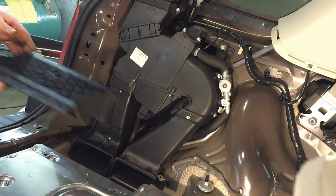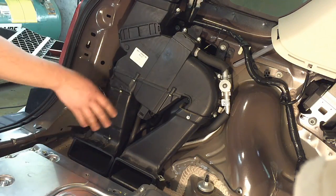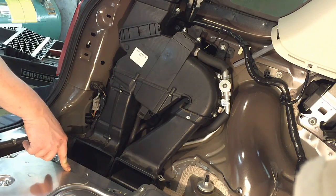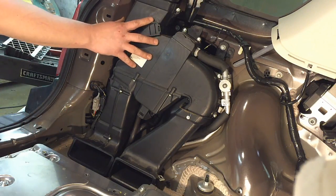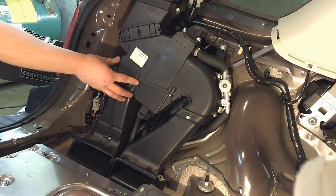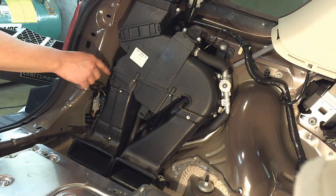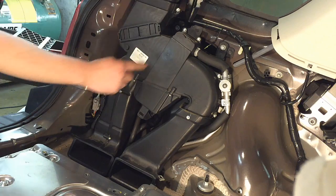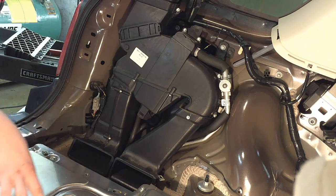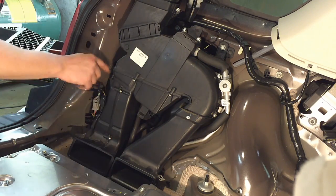Before putting on the last piece of ductwork that crosses between the HVAC case and the battery, here's a quick explanation of why this actuator is so important. The batteries need cooling more than anything. The actuator moves a door inside the case to either fresh air mode — where cool outside air comes in, cools the battery, and exits — or to recirculate mode, where air passes through the evaporator to cool and dehumidify the battery. Which position the door moves to depends on battery temperature and ambient temperature. That's why it's so closely monitored.